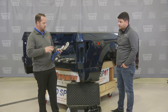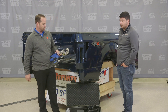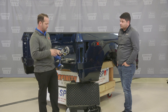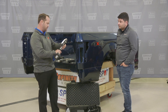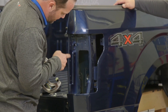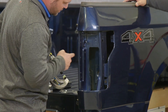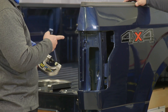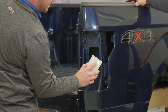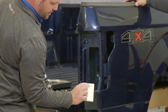We have the PR5 hooked up here with the 3mm extraction dies. We have three 3mm rivets here on the F-150 to show the PR5 in action. The back side of SPRs — the self-piercing rivets Ford puts in — always leaves a form side on the back, and on the front side you have a flat head. This is a 5mm example and these are 3mm, but you can see the idea is the same: a bump on the back and a flat head on the front.